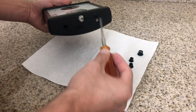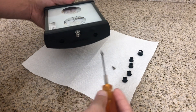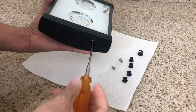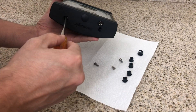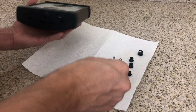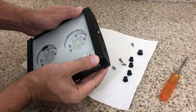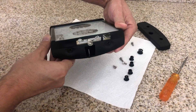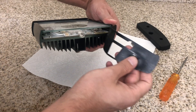The other side has the power jack that's directly soldered to the board. So if you did want to remove it, you'd have to unsolder that. It's probably not something you'll need to do — I'm just doing it for the video so you can see the other side. Just be sure you don't pull it since it is hardwired directly onto the board. Once you remove the end plastic cover pieces, you'll notice a little rubber grommet, which is used to keep moisture out if water splashes on it. Be careful when removing this, and again, don't pull that spring.